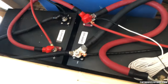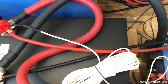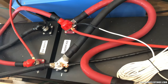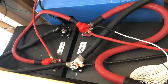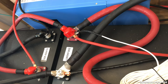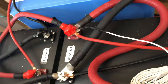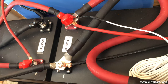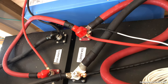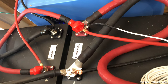There are two 100-amp-hour batteries here. This white wire checks the battery temperature — they literally never get hot though. They are lithium-ion batteries; I invested a ton in them and they're so worth it. They also have a self-shutoff system: if too much power is drawn and the batteries can't handle it, they go into sleep mode and shut all power off. The only way to bring them back is to connect them with jumper cables to the car batteries, which are right below — takes just a second and they're back to life.